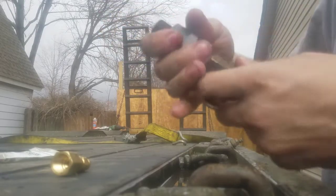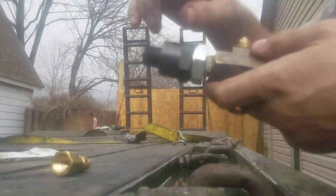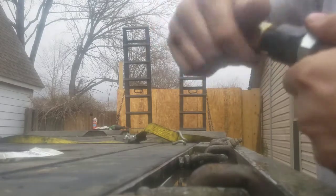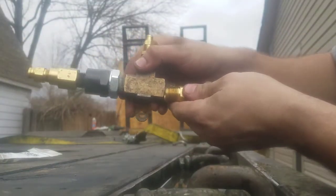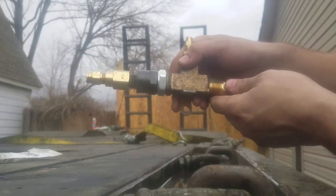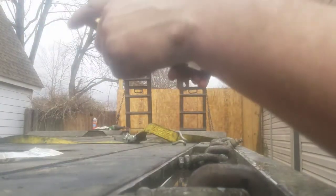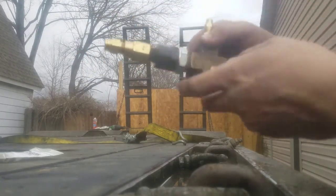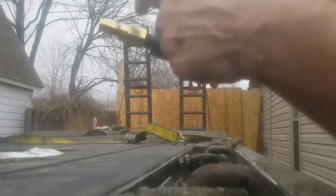What we'll do is take this off, and this one-way check valve will go on this. That way, the air will be allowed to come out of this valve down the frame rail and won't let it go back. This actually replaced this. You'll be looking at something similar to this to go on your frame rail. This will be your service line coming down your frame rail — it'll come off your ABS system and go to the rear glad hand, the rear service glad hand. This will be a through-and-through, and this one-way check valve will allow you to come through and not go back.